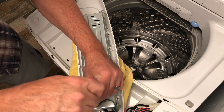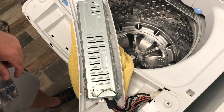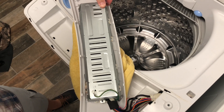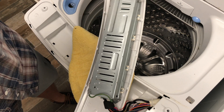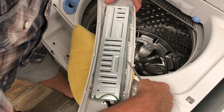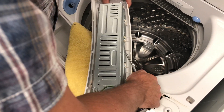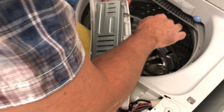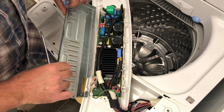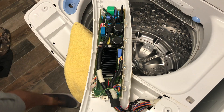Let's go ahead and take out our grounding screw here. You have just this one grounding screw, and then these little tabs right here you can peel back a little bit to help you gain access. Using a flathead screwdriver, just pop this thing out. There we go — that exposes the circuit board. Now we're going to take a closer look at this.